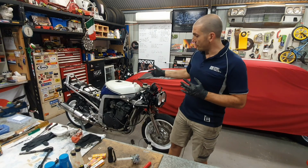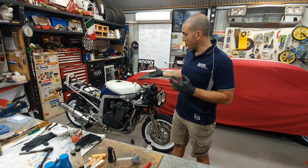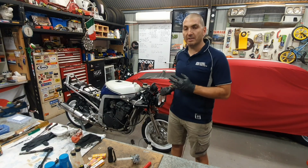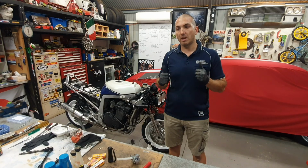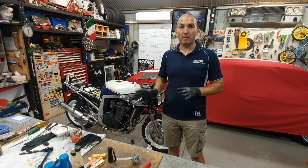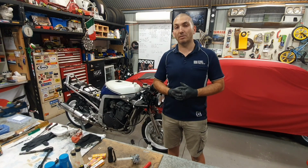Okay? Now, we've gone through carbing, spark, fuel, and compression. Put the tank back on, boom, it started, okay? So guys, that's pretty straightforward. It's really easy. Sometimes it's just as simple as just spark plugs, okay?